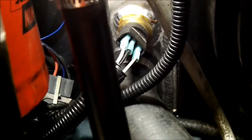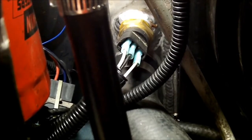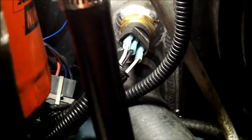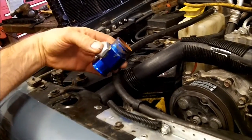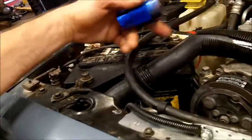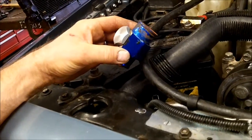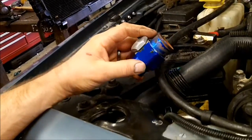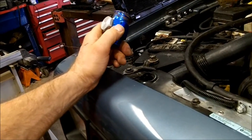One of the things I really like is the 22 millimeter bung that they welded inside of the tank here. I have a thermal switch there, which is part of my Taurus fan conversion — a two-speed thermal switch screwed right into it. I had originally mounted the thermal switch in the upper radiator hose on the hot side, where radiator fluid comes out and goes across the radiator. It worked real well, but being it's now on the other side, the fan's going to kick in late. I would have preferred the bung welded on the passenger side tank — I think that would be a better deal.